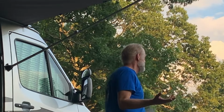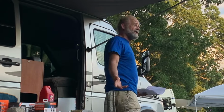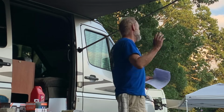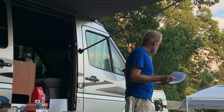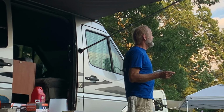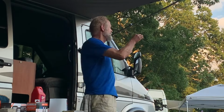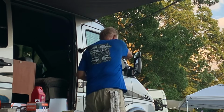What about the cheap light sources? I mean, I have to replace these H7s every year, you know. Sylvania's, it costs, I don't know what it costs anymore. It costs X. I can get just as good light bulbs on Amazon for half price. Again, don't do it. I guarantee you, there is no company out there other than Philips, which is a good brand, which is what Pep Boys sells down in Philadelphia, I know, and Napa, that can make a light bulb with the filament in the right spot. Japanese stuff, it'll look like an H7, but that filament will not be perfectly oriented where it needs to be in that reflector to put the light on the road.